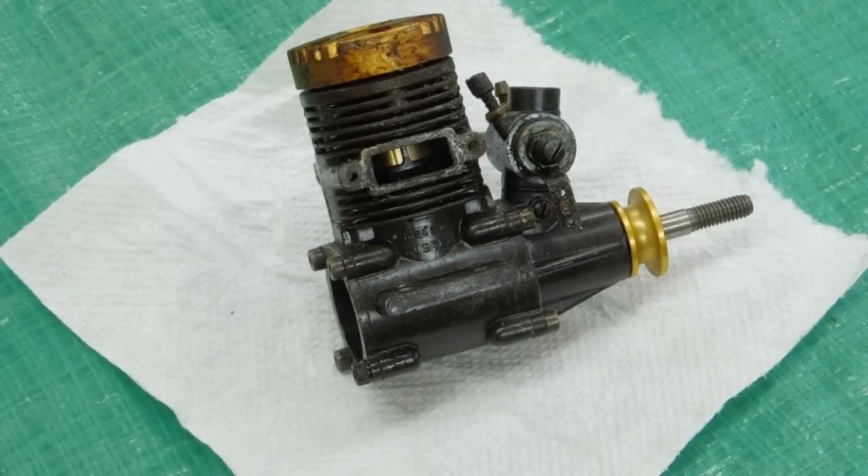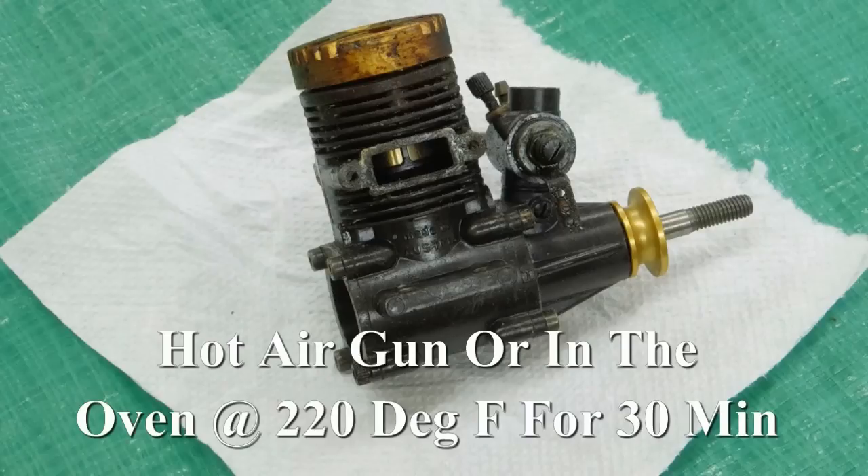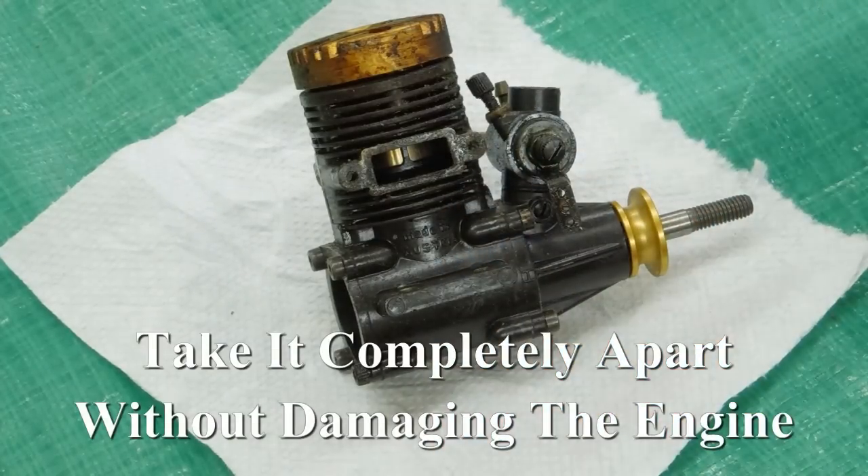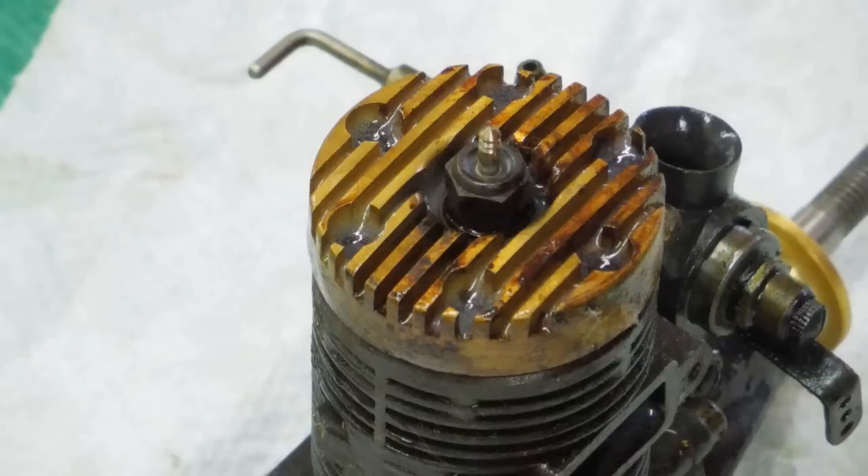Do a few re-applications for a day or so. After it sits, you can hit this with a hot air gun or put it in the oven at a couple hundred degrees and warm it up. Get a shop towel or an old oven mitt and see if you can work this thing free. The objective is to take it completely apart. When you get done, this is going to be pretty greasy, so rather than throwing it straight into the glycol, I usually wash it off with a little mineral spirits, get rid of that grease, let it dry, and then put it in the glycol.